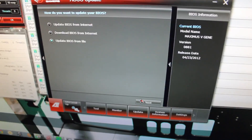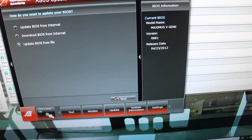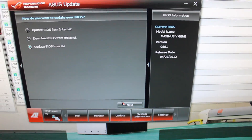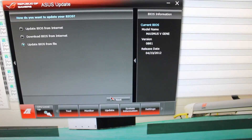The other way that you can update it is just going straight through the USB port at the back here — very easy to do. You don't even need a CPU in your motherboard to update the BIOS. You just plug in a USB stick into your IO plate, or you can do it when you're in the operating system, which is what I had done. So very easy.